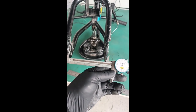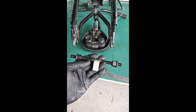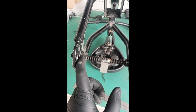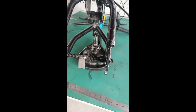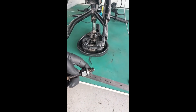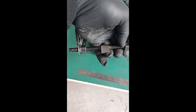This is how much we have to spread the frame. We have a spreading tool here. The spreader tool will have two washers on the inside - make sure you use the washers. If you don't, the nuts start grinding the frame and it gets really difficult. Make sure you put the washers on the inside like such.